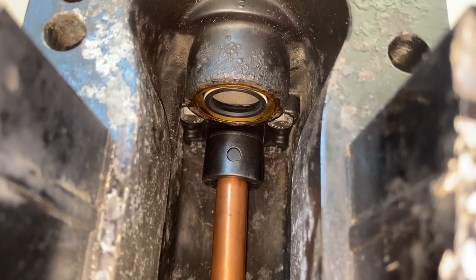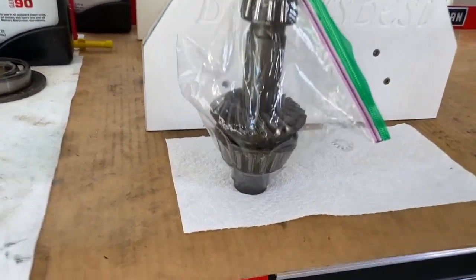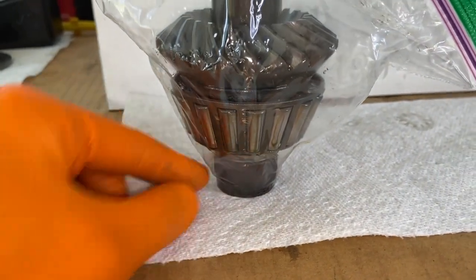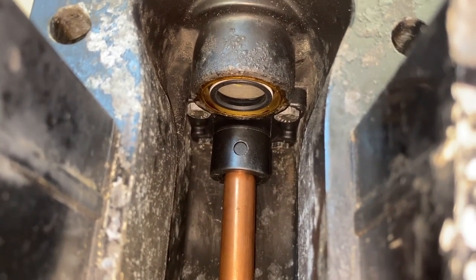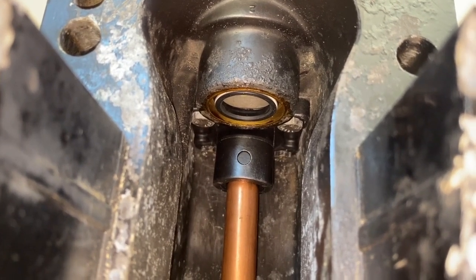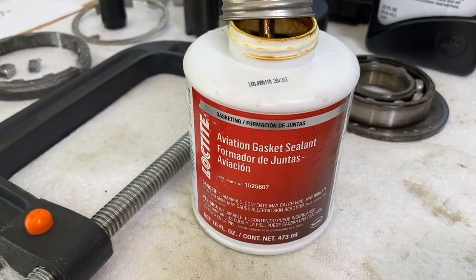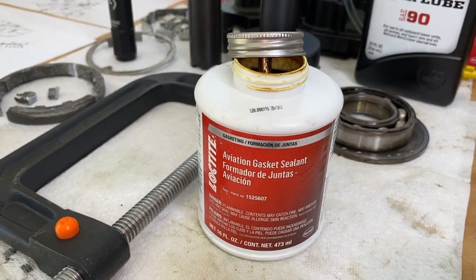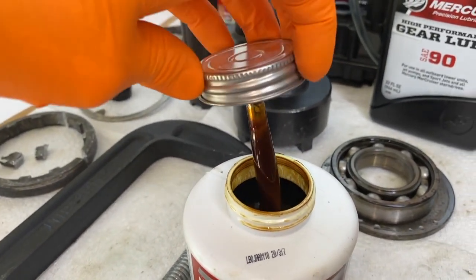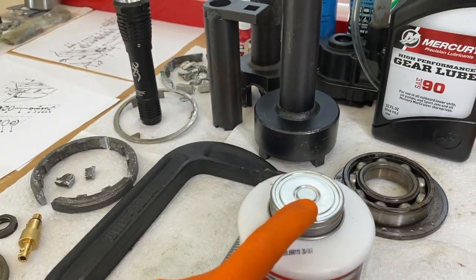Here is our old vertical gear that came out of the upper unit. The base portion right here is what the oil seal grabs hold of to create an airtight seal. You can also see gasket compound around the oil seal. If you installed the oil seals without gasket compound, that's another common cause of a leak or unsuccessful pressure test. The compound we used is aviation gasket sealant — the part number is in the description and comment section below, along with a purchase link. It's very thick brown stuff, and if you do not apply it to those brand new oil seals on your upper unit, that is a problem.